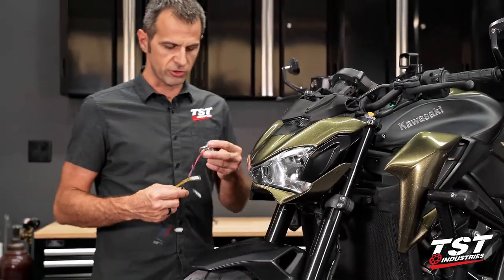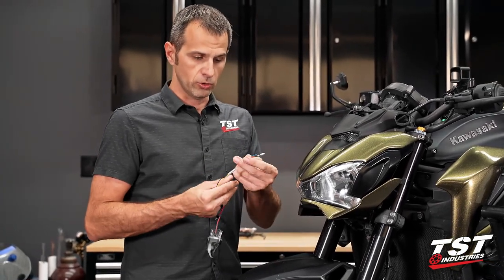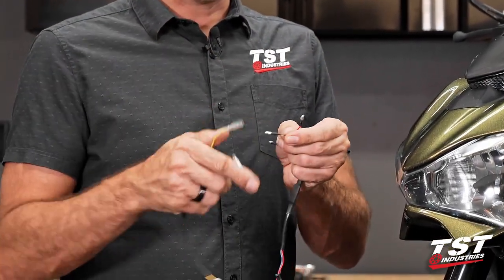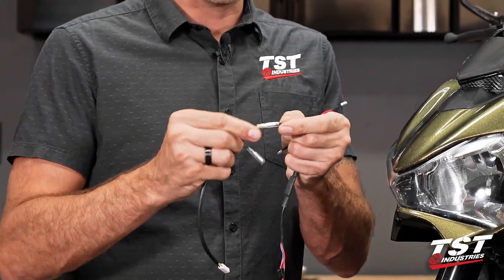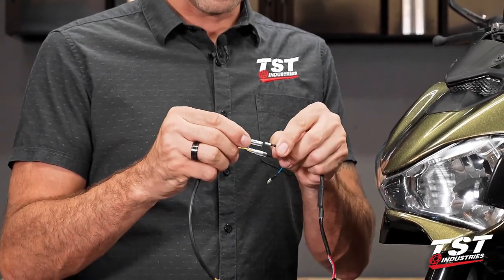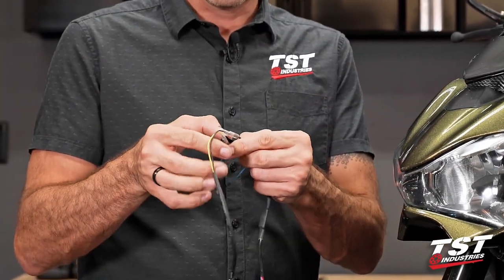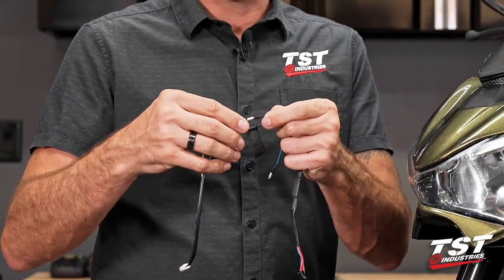The procedure for installing this light in the simpler mode, without a running light: you will basically just pre-configure it like so. The blue wire gets not used. The brown wire gets plugged into yellow. Make sure the insulating cap is over the connection. And red goes into black — again, insulator. I'll use some electrical tape to fix these insulators in place, as they do have a tendency to move around.